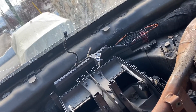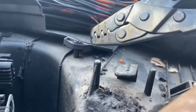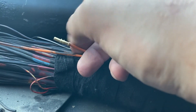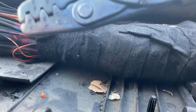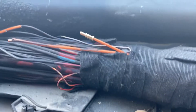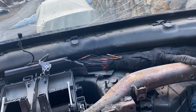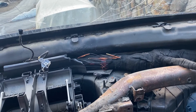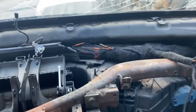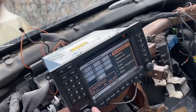Strip those back and put the ends on. It's hard to do with one hand so I couldn't film it, but effectively you want to put the inner ring — right in there — between this one and this one, into that 14 to 18 slot. Do that for both sides, then connect your jumper. That's how you get around replacing the whole thing or using a piece of vacuum hose. I wanted something quasi-permanent — if I put the dash back together and it comes apart, I'm not pulling the whole thing apart again.